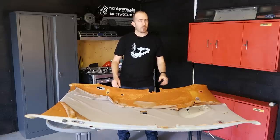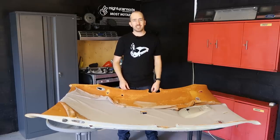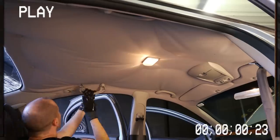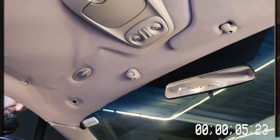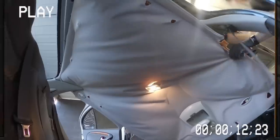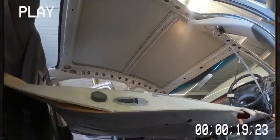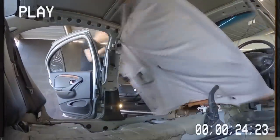I've already removed my headliner from the car but if you need some tips on how to remove yours, this is how I did it. To remove your car's headliner you firstly need to remove everything which is holding it up there — this includes the grab handles, map lights, the centre light, pillar cover plastics and also the front sun visors. Once you've got everything removed it's just a simple task of getting the headliner out from behind the pillar plastics and then out of the car. On a Falcon or a Commodore this is actually fairly easy to get it out of the passenger side door opening.